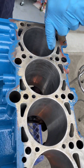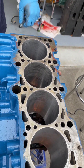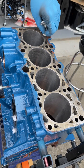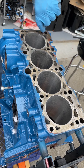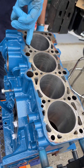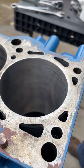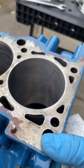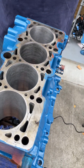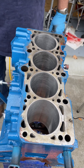There's a little lip right there — I did use a tool to cut the lip back, and apparently I can see I didn't quite get all the lip, but I'm going to call that good. On this side it's all gone — uniform gray all the way down, just pretty, and that's what you're looking for. You don't want the drill turning really fast, which would heat up your stones. Go nice and slow, up and down — that's pretty much it. Best of luck to you.